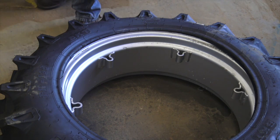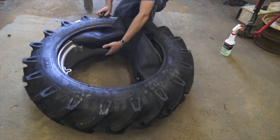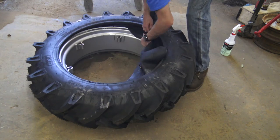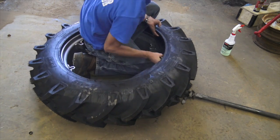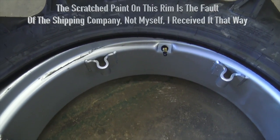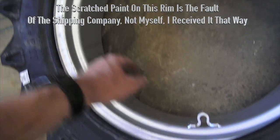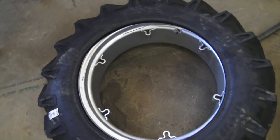Now we have to figure out where I left the tubes and shove one in. That was harder than I thought — I'm a little out of breath — but I got it in. The thing is, when you do stuff like this for the first time, things you think will suck are often easy, and things you think are nothing to it give you a good workout. I forgot rule number one: line up the valve stem first, because then everything else finds its own place. I had the valve stem way over on the wrong side and was yanking it around, but we got it.